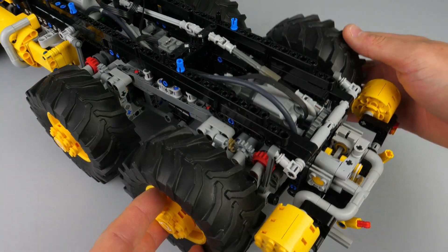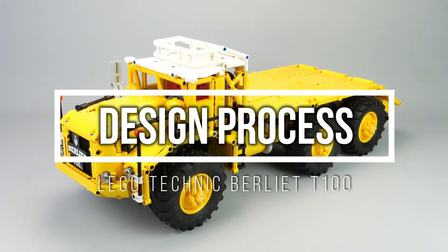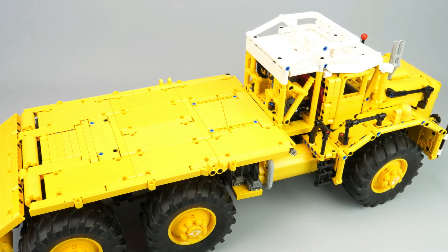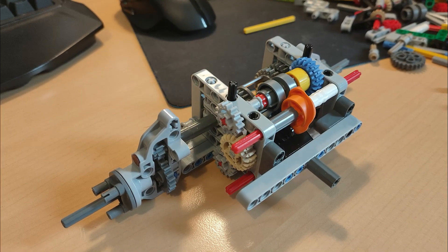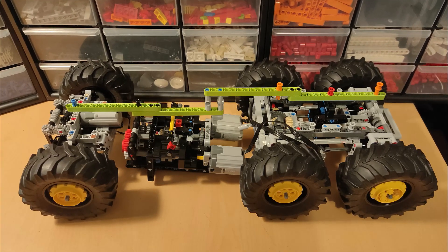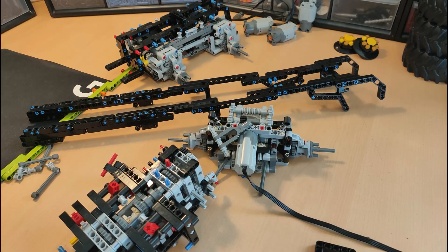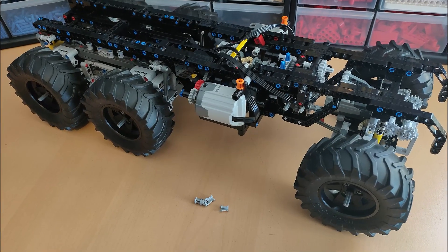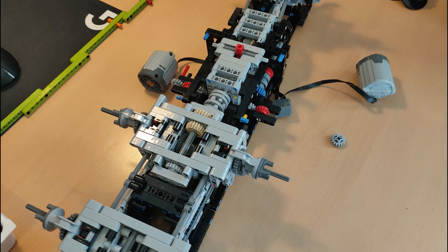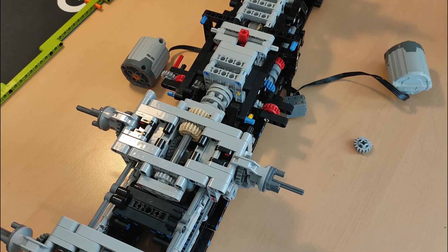All these functions are attached to a chassis designed to be as strong as possible. The design process was complicated. I first wanted to replicate the complex drivetrain of the T100 with a gearbox, transfer case, and central locking differential. I started designing the axle and connecting the gearbox and central differential. Testing revealed cracking sounds from the gearbox on climbing, so I reworked the gearbox and central differential to handle more torque. After further testing, the gearbox and differential were fine, but the transmission shaft on the axle broke, mainly because of high torque on the U-joint. I tested more gear reduction after the U-joint and reinforced U-joints, but the drive shaft still had too much torque to handle.